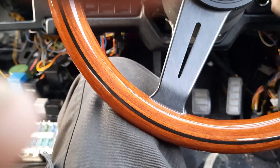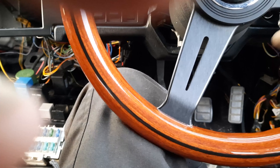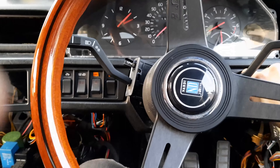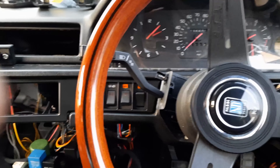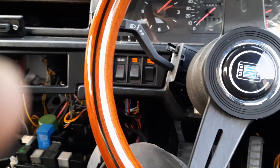Oh, but the clock's going. Didn't get any lights though. Oh, but is the dimmer down? All the way there. Yeah, it is. Do it again - turn it on. That's the fuel pump going. So that primed. That clicked in there - something. Yeah, that's the fuel pump relay down there. That's right, and the main relay.